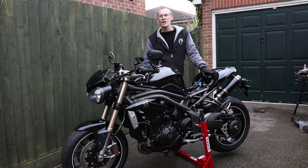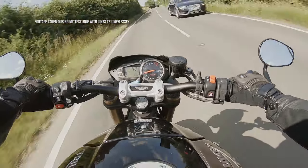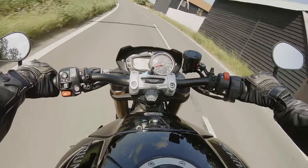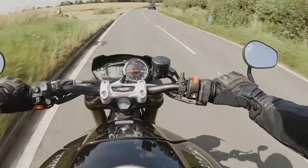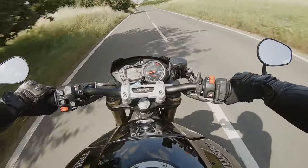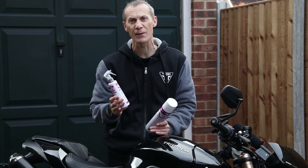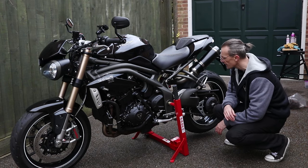The bike is now protected, but for how long depends on the type of riding you do. If you have a winter ride and the bike is covered white with salt, a quick wash off with cold water and the salt is gone but the bike is still protected. A lot of bikers are summer riders only, in which case you won't need to touch it again until the end of the year. If you keep washing your bike with shampoo you will eventually remove the ACF 50, but you have already helped protect the bike from rusting. Even if you don't ride in the winter, I would seriously consider applying this to your bike to give it full protection from the rain and damp conditions.